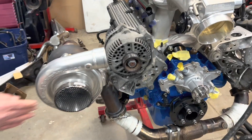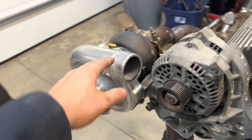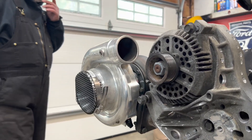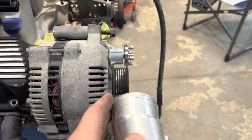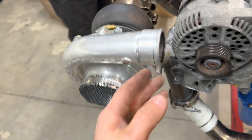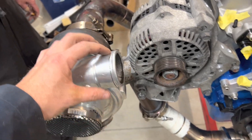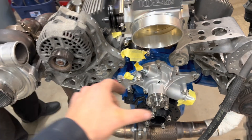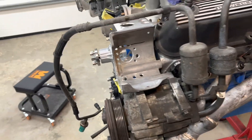Here's what we're looking at. We've got all this stuff just kind of bolted down just to mock it up. The turbocharger looks like that's going to be fine - we can still angle this up a bit more if we need to, and it's got enough clearance. We can figure something out, especially if it's a little bit higher. Or maybe this gets chopped off and a 45 elbow gets welded onto the housing, and that kind of brings it out so we're able to more easily bring it in. This part I'm not super worried about, looks really good. This stuff over here - holy cow, is it tight.